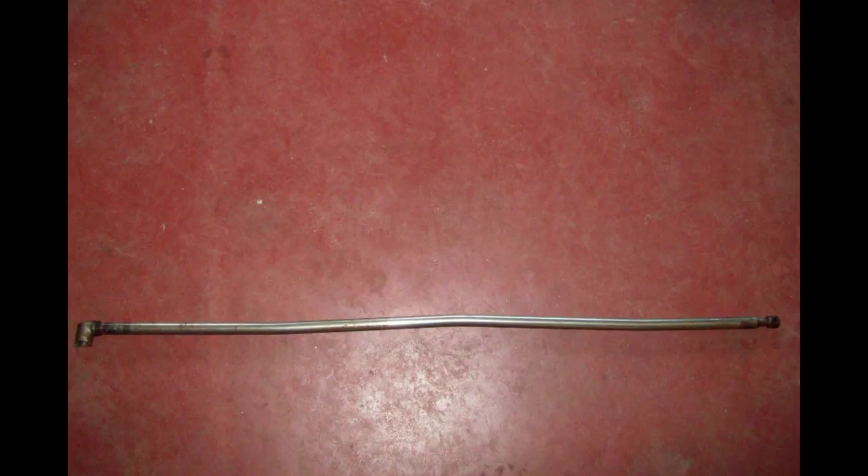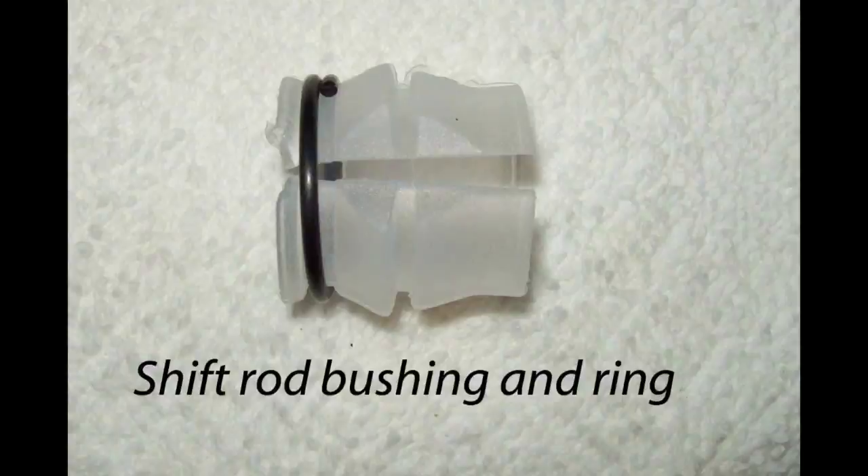You may want to pull this tube all the way out, clean it real good, and put some grease around it over the first eight or ten inches — enough to go into the bushing. Now let's install that bushing. The left side of the bushing as shown here in this photo goes to the front of the car. Grease this bushing good and slide it into the bracket on your tunnel to where the groove is on the bushing. Once you start installing that rod into the bushing, the bushing will be expanded enough to where it won't come out of that bracket.